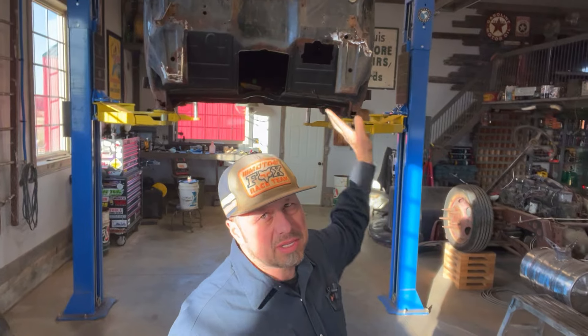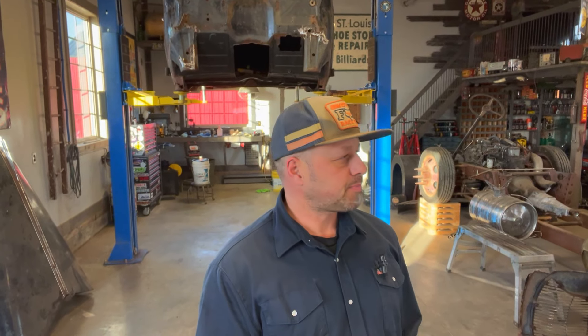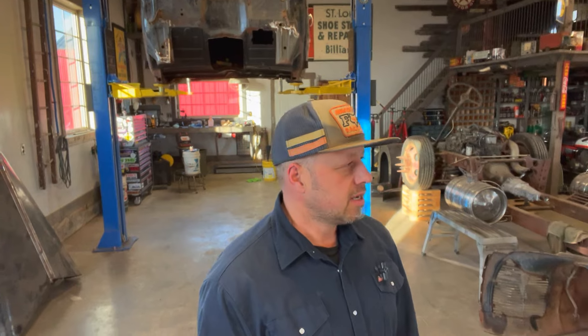So we're back in the garage. We're going to be back to work on this old little Pontiac here up on the lift. I did get that power steering pump changed - seems to be working good. It didn't start right away. Turns out what it was, on the side of the bracket on the side of the engine there, there was a ground that fell off one bolt that I pulled out that I didn't notice. Got that done, found that ground, hooked it back up, fired right up. So it's good to go now.